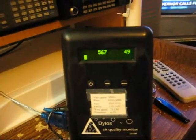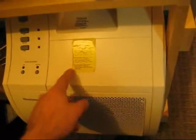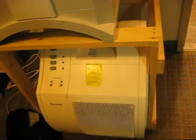The counts are about 500 to 600 on the counter, which represents 50,000 parts per cubic foot. We're going to turn on the IQ Air on level 6, full power. We're going to run my Honeywell HEPA filter underneath it to kind of pre-filter it. That won't affect my test because this only draws so much air — you can't really force air into it. So it won't make a difference for the test, and it will filter out the larger particles to protect the IQ Air. We'll get the test underway and crank it to level 6.